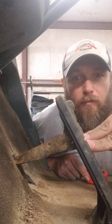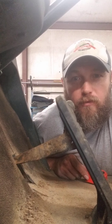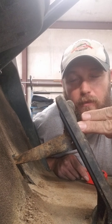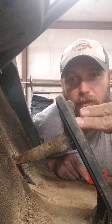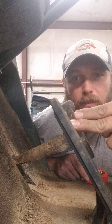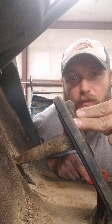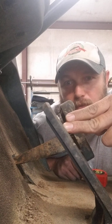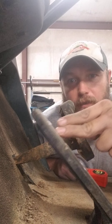What we know is that brake free play for the Yamaha golf cart needs to be between one and two inches. They actually give us dimensions in millimeters, but it boils down to being between one and two inches. Meaning I should feel tension in those cables when I press the brake — I should start feeling tension between one inch of travel and two inches of travel. If I start feeling tension immediately before I even get to one inch, it's too tight and it'll cause a lot of overreacting in the brakes. If I go further than two inches before I feel tension, players will start complaining that there's not enough brake. That sweet spot they've found is between one and two inches.